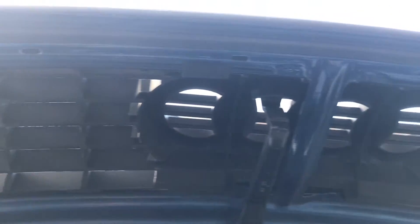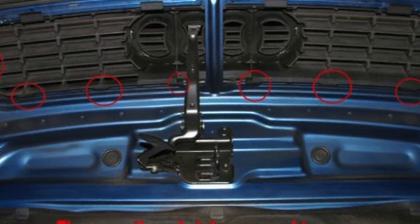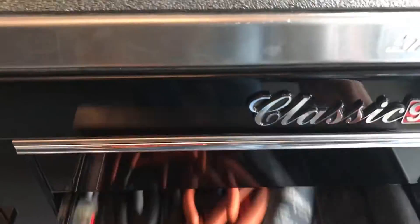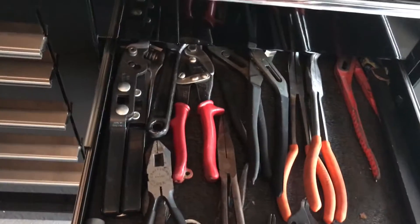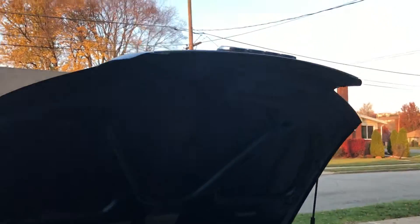The grill is directly attached to the hood. What you're looking at over here — it's hard to see at this angle, but I'll put a picture in the description — there are a couple of tabs holding this in, that's all it is. I'm going to go ahead and start removing the tabs. What you're going to use is a nice pair of pliers; needle nose would probably work better. Then I'll start disassembling the grill and we'll come back after it's all out.